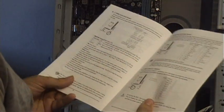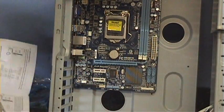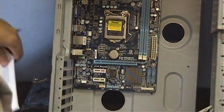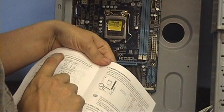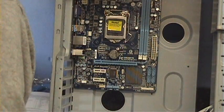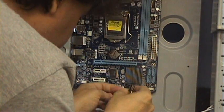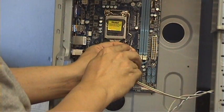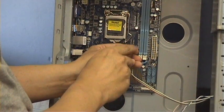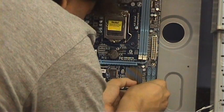It's slightly better labeled in the instruction manual — which of these pins is which — so I'm just going to have a look. I just realized I haven't got the microphone on, so I don't know how well that was picking up. Right, let's see what we've got here: front panel header. Let's do the bottom ones first. Hard drive light is those two right in the corner — HD LED. I'm going to assume that the red wire is positive, because on the power LED wire, positive is the colored wire and the negative is the white wire. I'll just put that in there.